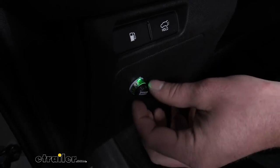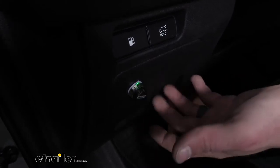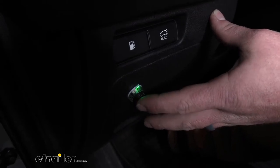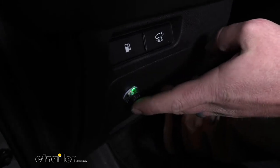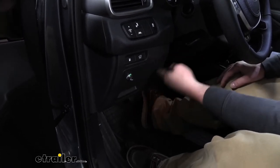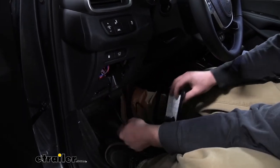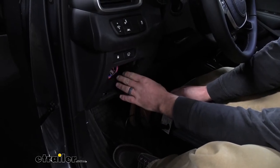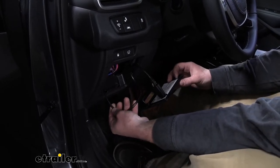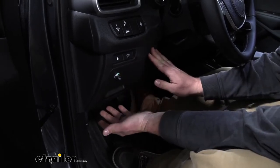You can adjust your braking force by turning the knob — zero being the lowest, ten being the highest. This also has a manual override: when you push down the button it applies just the trailer brake, which you'd use in a sway situation to slow the trailer and straighten it out. And since the brake controller mounts behind the fuse panel cover, you can still access the fuse box by pulling it out — there's more than enough cable. If you ever change vehicles, you can pull the controller out and simply replace the fuse panel, so no holes left in the dash.